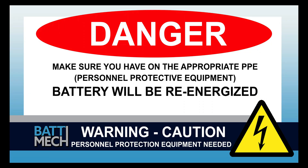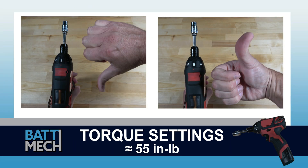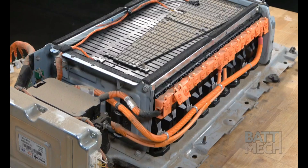The rest of the reassembly of the battery pack will re-energize the battery. Your shop may have different protocols to keep you safe — it's always best to follow your shop's safety protocol. Before attaching the wire harness, be sure your torque settings on your torque wrench are set to about 55 inch-pounds. If you don't follow these torque settings, you are likely to damage the terminals on the modules and will void your warranty. Never use max drill settings, and never use an impact wrench. Before continuing, be sure these four wire eyelets are positioned in the correct locations as shown here before attaching the nuts.